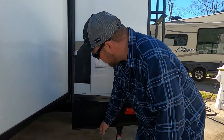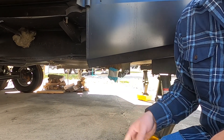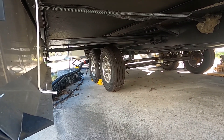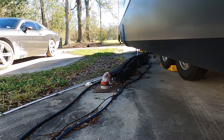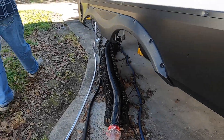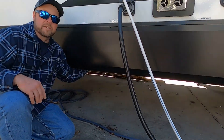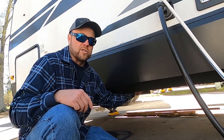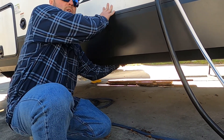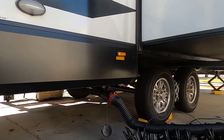So right here, this is the valve to the gray tank in our kitchen. I'm going to pull this. It's going to take a minute, because it's got to come from over here and go all the way around and then come out. It's going through the hose now, as you can hear it. Now that right there is all water from our kitchen sink. You can come right over here to your other gray valve and open it up too. Yours may be in a different location, and that's okay — you're just going to have to find where those spots are, but it's always going to be on this side of the travel trailer or RV. I'm opening this one up. Now that one just joined in with the other.